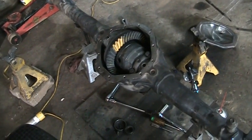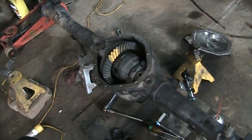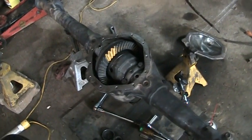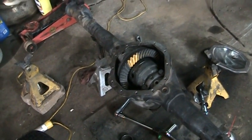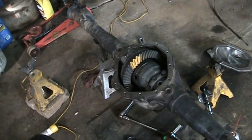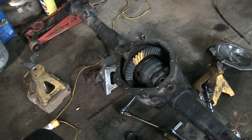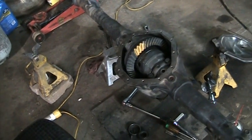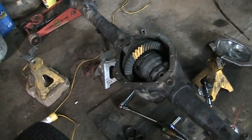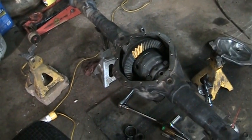So I'll have to take the pinion, install it alone, take it to 200 foot-pounds, and then I'll take a dial inch-pound torque wrench and start spinning it. You don't take the measurement when it first starts to spin, because that's not what you want. You want the measurement from that inch-pound wrench as it's moving, so you have to have kind of a steady hand rotating it and get it the best you can. This one is between 20 and 25 inch-pounds to be set for the free rotating torque.